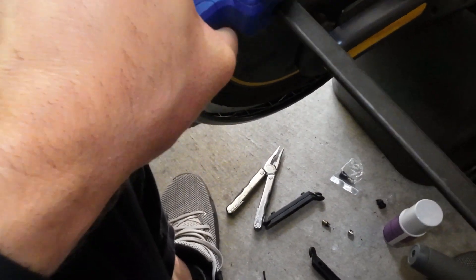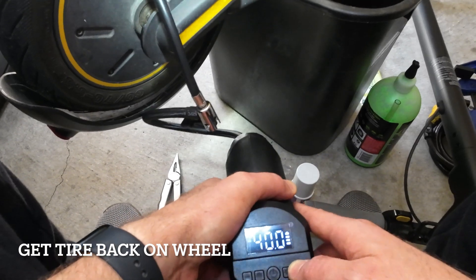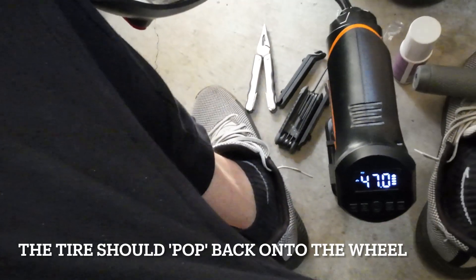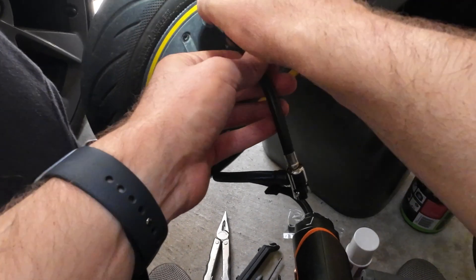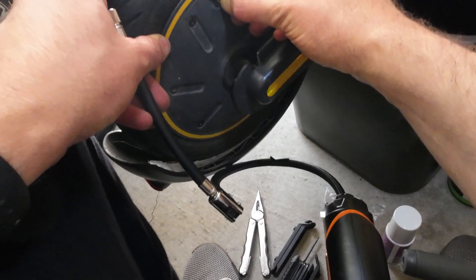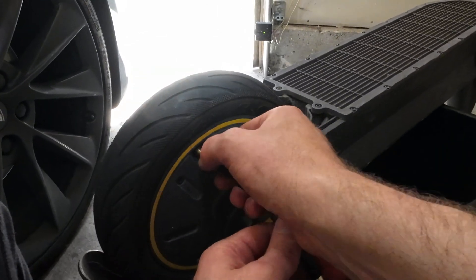I'm going to take this off. Time to let the tire go back to somewhat normal — maybe 45 PSI if I can pop this sucker on here. I think that actually did it — popped back on, heard the pop. Pressure is a bit high for my liking right now, but I'll deflate it again to make sure it's fully seated. It does look properly seated. I didn't actually use any soap water, which I've seen in a lot of videos, but I got it anyway — victory!